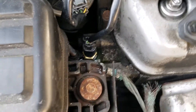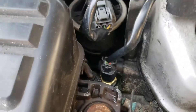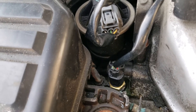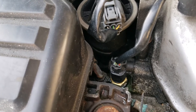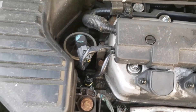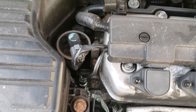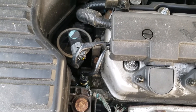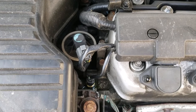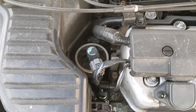To clear the engine light, you could just drive it. You can disconnect the battery cable for about 30 seconds and it'll reset the light, or reset it with the scan tool. But I like to just drive and let it go out naturally, because when you drive it and the code is fixed, it'll turn itself off. You'll know the sensor is working because the gauge on the dash will read at normal operating temperature — the hand will go up to the middle.